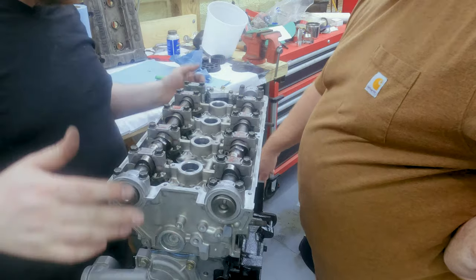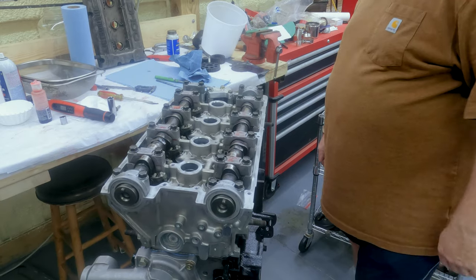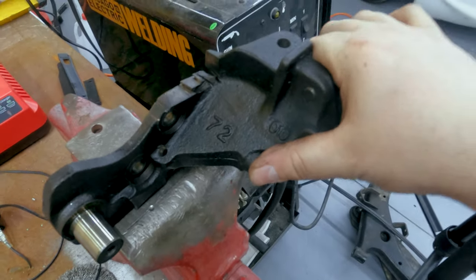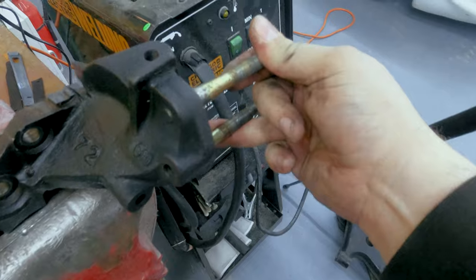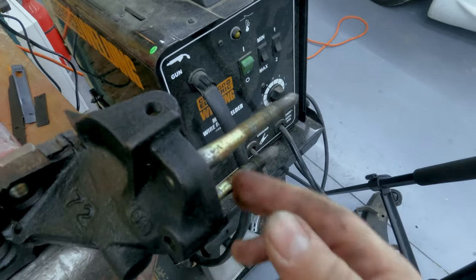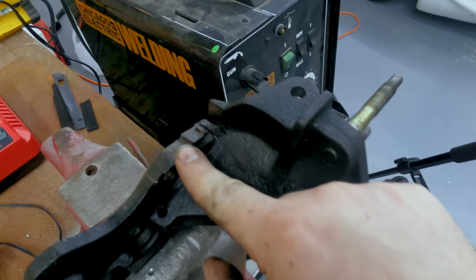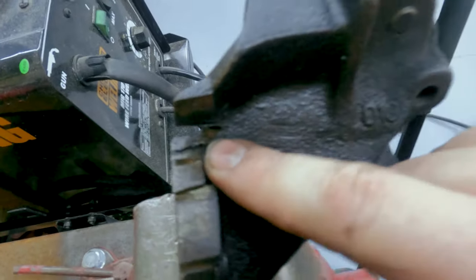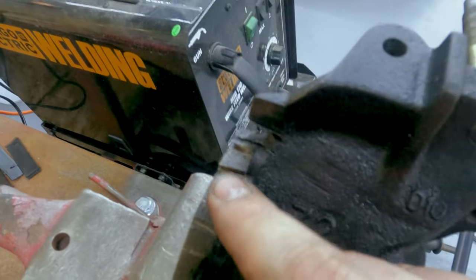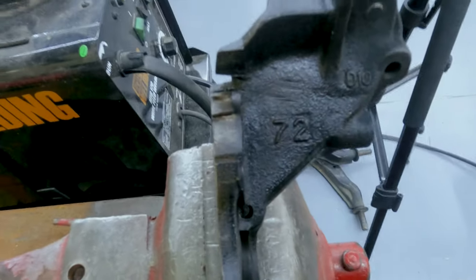All right, there. The head is on. Sitting on. Now we'll just bolt it up and torque it up, and it'll be on for real. Okay, so as some of you may know, when you use a 6-bolt in a 2G, you have to use the 2G motor mount because this is how this all lines up with the timing side engine mount in the chassis. So you have to clearance this little spot right here for the 6-bolt water pump. Well, whoever did this swap, they clearanced it. But it looks terrible, so I'm gonna clean this up before we powder coat this and make it look real nice, because that looks terrible. Just terrible.